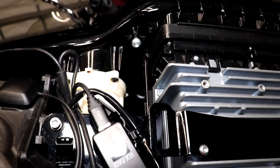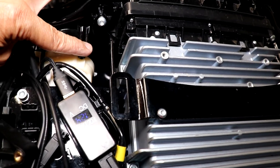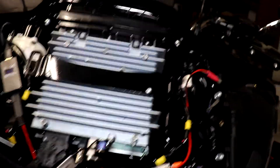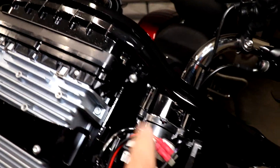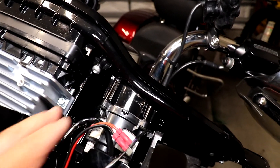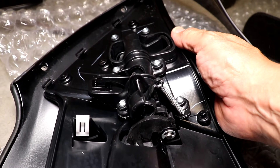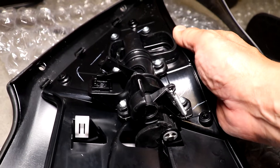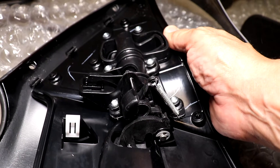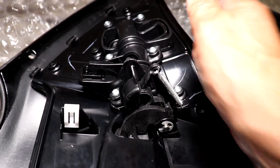It's important to note when talking about the top duct to keep the area between the bracket and the instrument clear, because there are parts that go down in there when you open and close the vent. So on both sides this area needs to be kept clear. Here's the bottom side of the top duct — you can see that arm goes up and down and goes into that slot. You want to keep those slots clear.